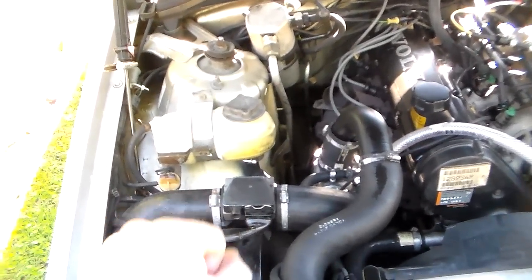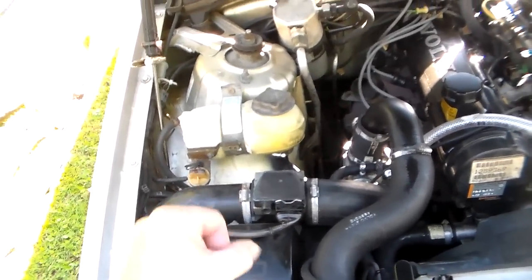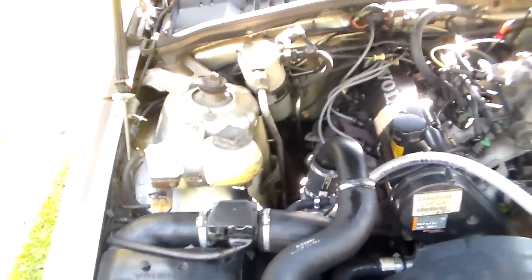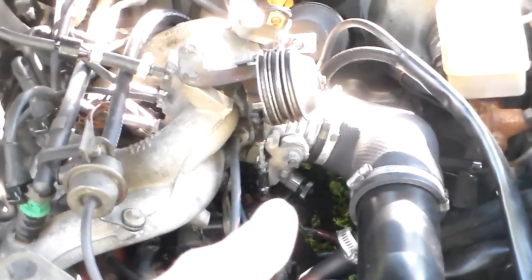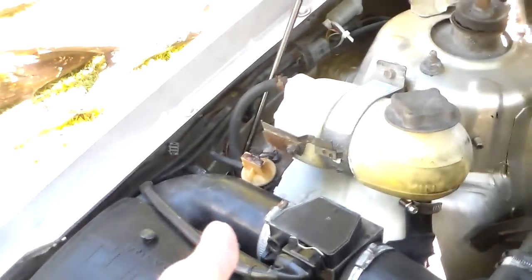And so I just simply got out here and thought, well, the heck with it, I've got nothing to lose, so I'm going to crank this thing up, and it idled up and idled up and idled up. And let me share something else with you. Under here, I've already noted this, I think, on the video, but that little thumb screw... These cars can confuse the heck out of you. You've got a base idle adjustment, then you've got that thing under there, that's your fine-tune idle adjustment. Before I adjusted the other one at all, this thing would have no effect on anything. You could crank it all the way one way or the other, nothing.